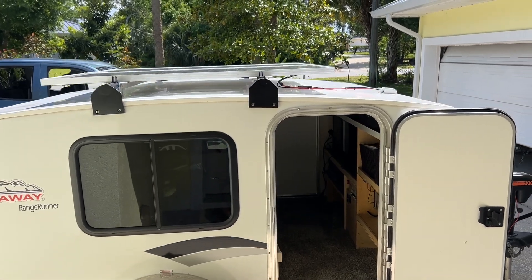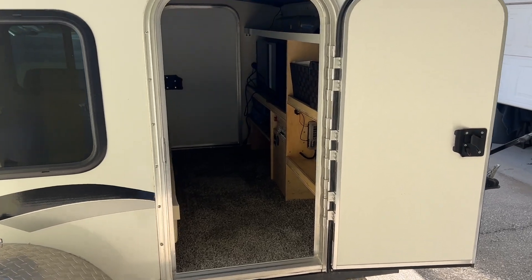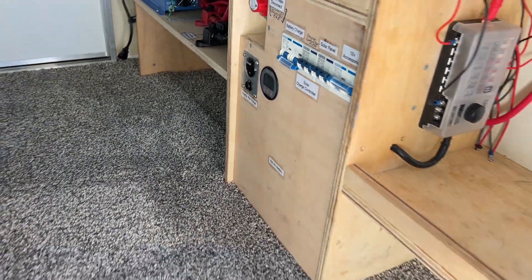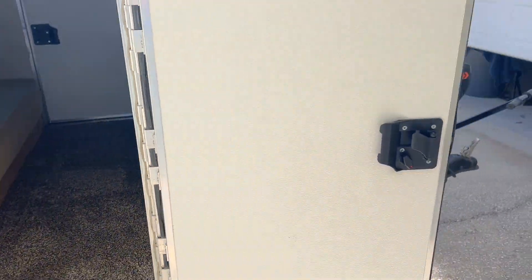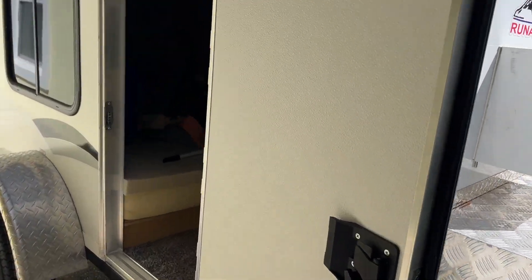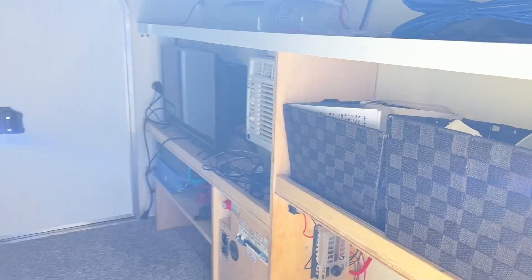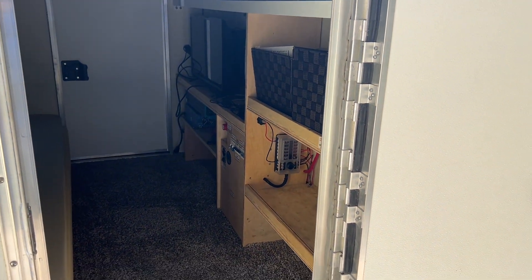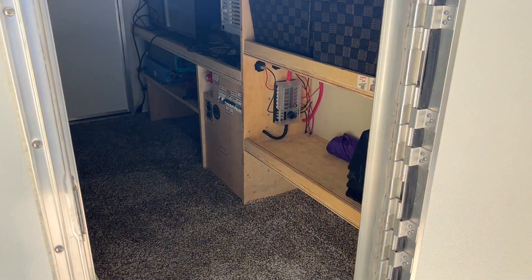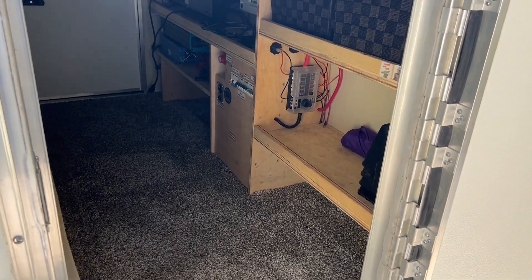This is my little boondocking camper. I have 400 watts of solar on the roof, but currently I only have a 200 amp hour battery in this compartment. I need to increase that capacity because right now I can run the air conditioner — I have a small refrigerator I put outside and a TV — and when I'm running all three I just have enough capacity to give me air conditioning overnight, but I don't have any reserve. I need that extra 80 amp hours to give me a reserve, so we're going to replace that 200 amp hour battery with the eco-worthy 280 amp hour.